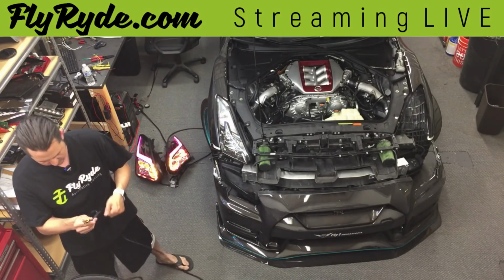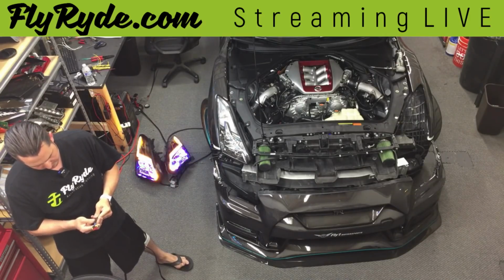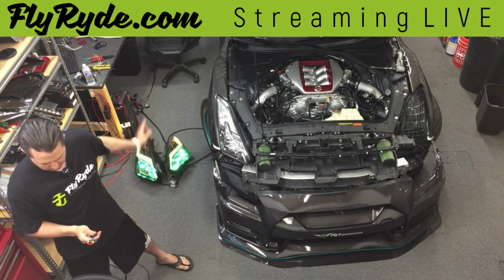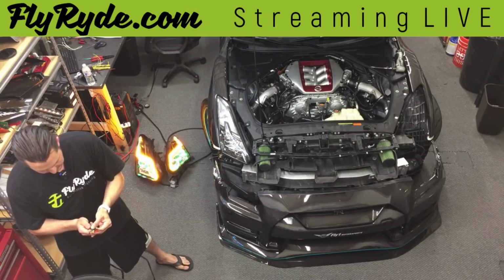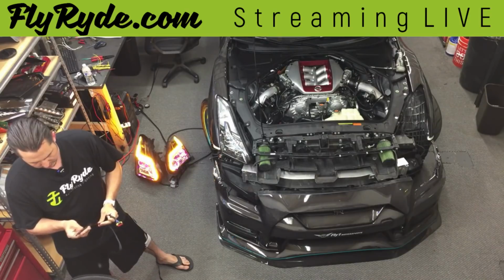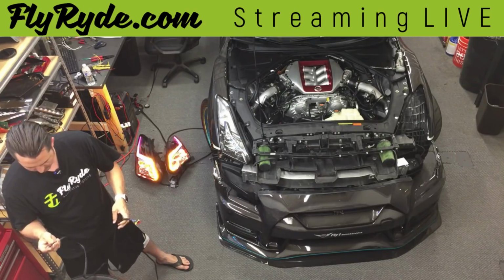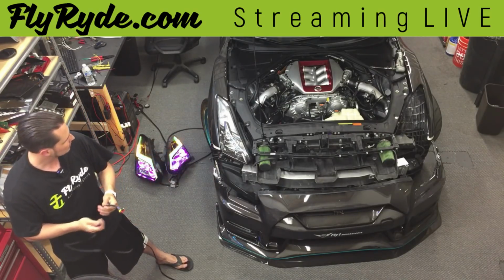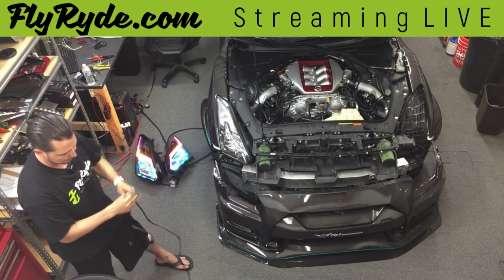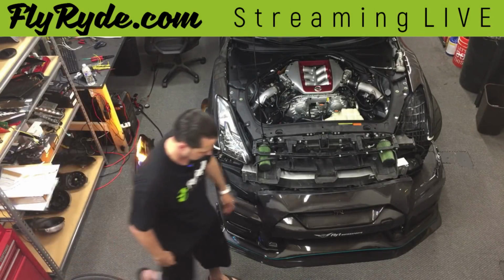What I need to find though is that if I don't have an extra wire coming out of this, I'm not going to be able to do what I was supposed to do. This should have 4 total wires. One of them's ground, one of them's power. Those things are not used by the remote control setup, like that guy over there. But I did have 2 extra wires, one for strobe power, turning it on and off, as well as, yeah, this is not right. I also had a wire that changes the mode for strobe, so that we could bounce lights back and forth across each other. In any case, I'll go ahead and pull this light off the car.